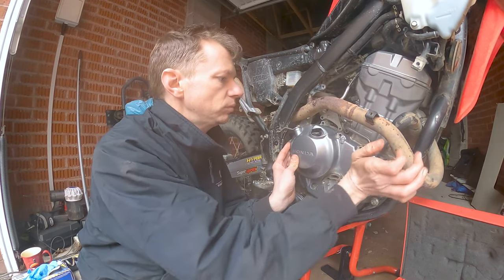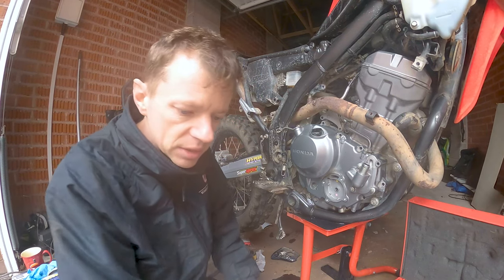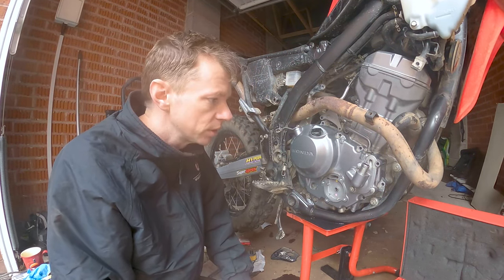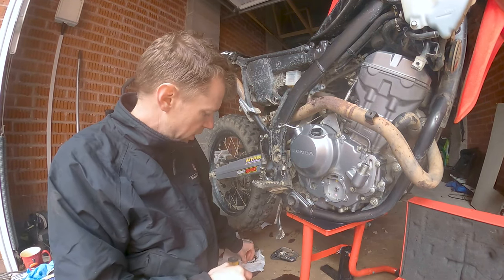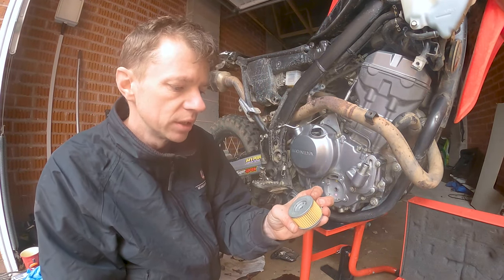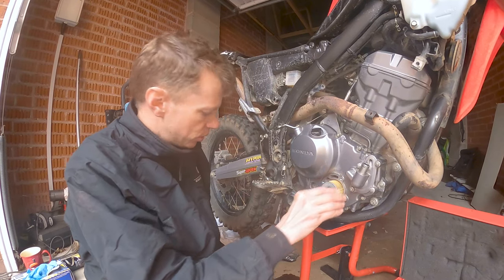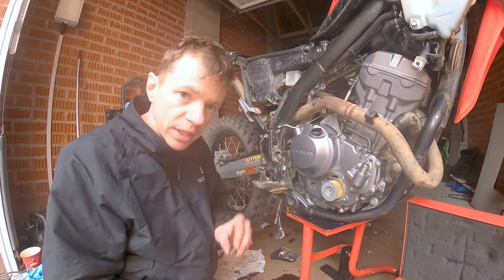Carefully offer the cover back to the bike — a little tap and we're back on. Here's the old oil filter — pretty manky to be honest — and there's the old gasket. Always get a new gasket. Now for the oil filter: build up the cover first. Your filter actually has 'outside — this side towards cover' written on it so you can't go wrong there. But watch out for the little spring that sits inside. Your filter goes on first, then pre-position the cover with a couple of bolts to hold the gasket together, and don't forget the little spring.